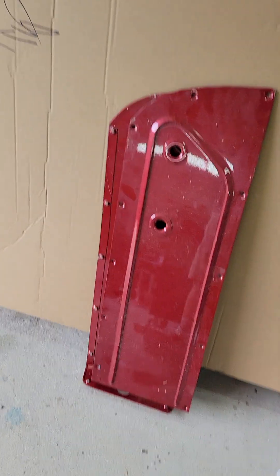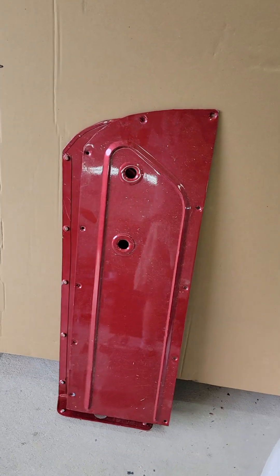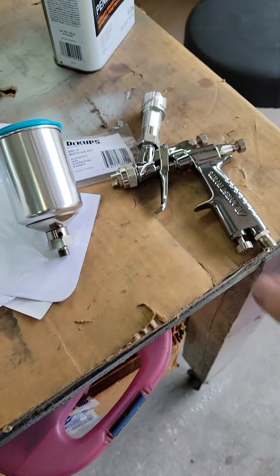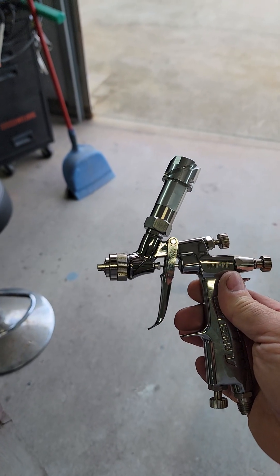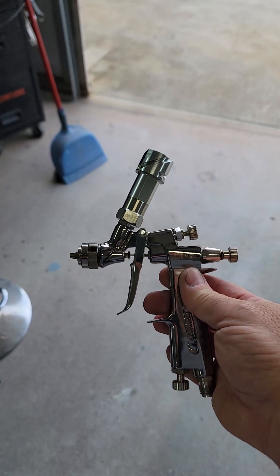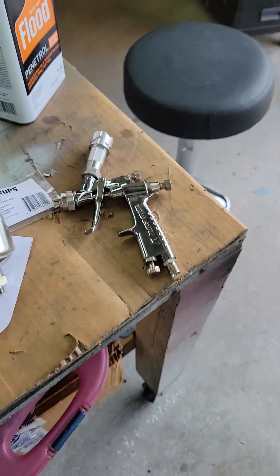What I'll do is scuff and paint the new pieces on his truck doors and the glove box using this little LPH 80. There's no sense in using a big gun if you can apply paint without a lot of overspray, and this little gun really does do good.